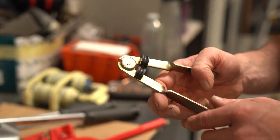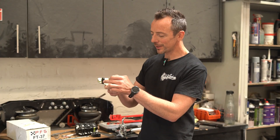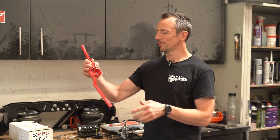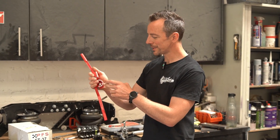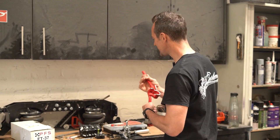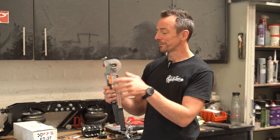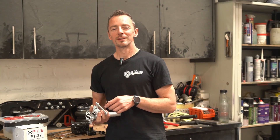After that we use the folders. This little folder is for the 3/16 — or dash-3 — brake pipes; it gives you very nice tight radiuses and a nice clean professional look. Then there's your more general one most people have seen — it goes up to 10mm and you can do your 3/16 brake pipes in there, but it's much more of a drawn-out radius, not as tight as the other one. And of course you've got these ones for larger sizes — most people wouldn't need these, but we've been doing quite large fuel lines and airlines on this car, so this is perfect for that.